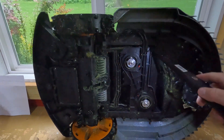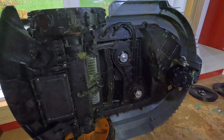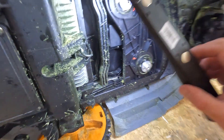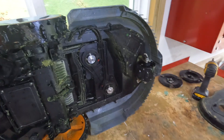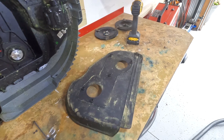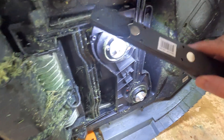There was a decent amount of grass packed behind here. I don't think that was the mouse making its nest — it looked like it was naturally packed in there just from use as the mower. I don't see any other foreign objects, and thankfully I don't see any wires that are nibbled on, so maybe the mouse was just a coincidence. Also on top of the shroud there was a lot of packed-in grass, so maybe it was just bound up.